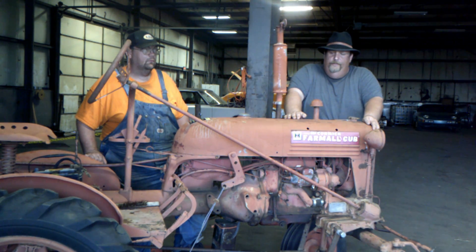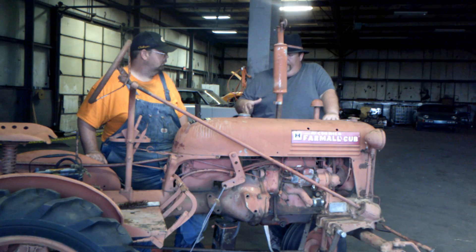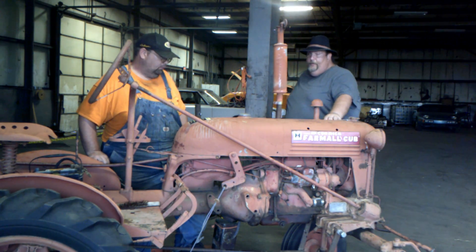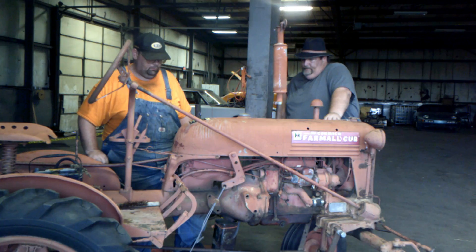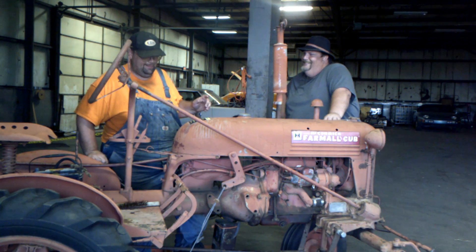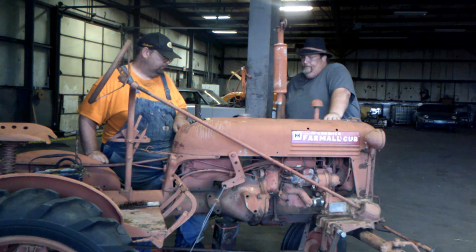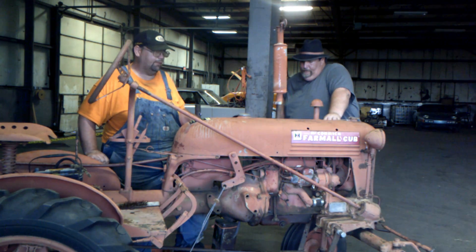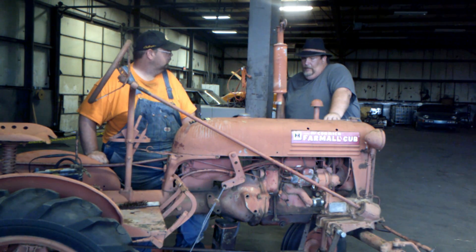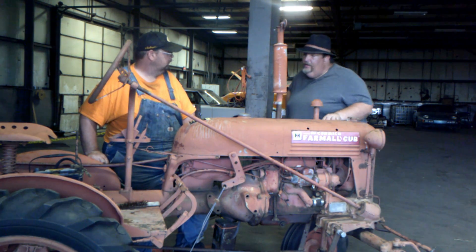Me and the doc started working on this one and we've come into a few things it's going to need. Dan, let them know what this project contains. It has a few major problems: the ring gear on the flywheel is all chewed up, and the carburetor needs to be cleaned up better. Other than that it wants to start — it's got good spark, lighting that little spark tester up like a Christmas tree — but when we were trying to start it, it just wasn't grabbing that flywheel at all.